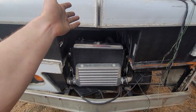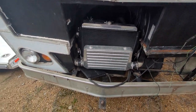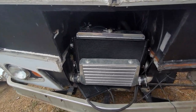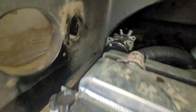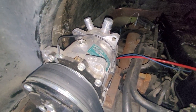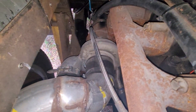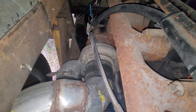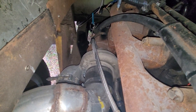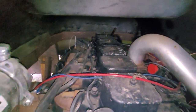I'm going to go front to the back, underneath, and then inside, then to the roof — hopefully before it rains. New trans cooler, new intercooler, AC condenser, new radiator. Everything works, no leaks. This isn't hooked up, but the compressor is in. I plan to run a vintage air unit under the dash, which obviously I never got around to — it was at the bottom of my priority list. New rebuilt HE351 turbo. All the piping is ran — cold side, hot side, intake side, everything.